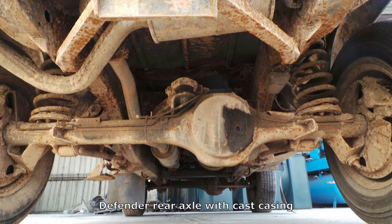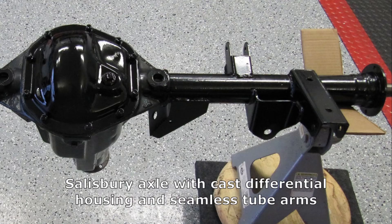Several people who commented on the failure of the Isuzu D-Max rear axle noted that these days these rear axles are too light — they've been optimised over the years. The Defender rear axle is a casting and the two arms are 88mm OD and 6.7mm thickness. We can replace these arms with seamless tube at the same OD but only 4mm thickness, and furthermore if you buy the tube in high-strength steel with 350 newtons per millimetre squared yield stress, you're going to get the same static strength.